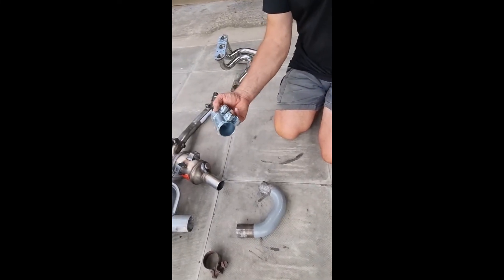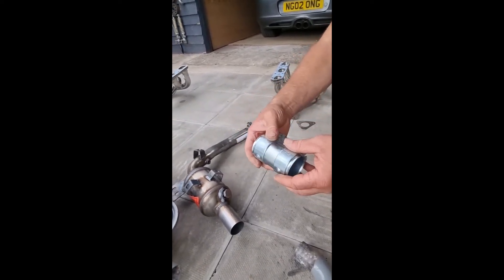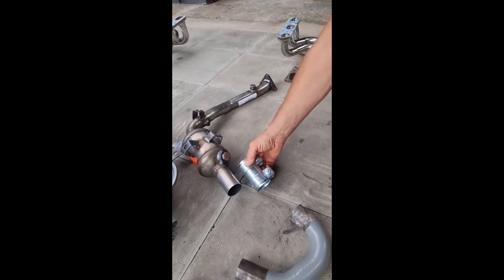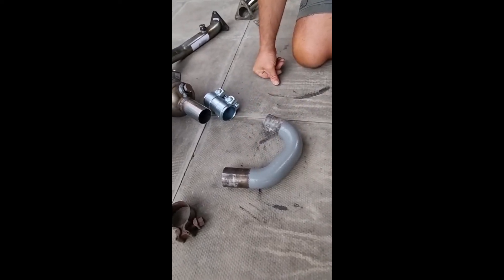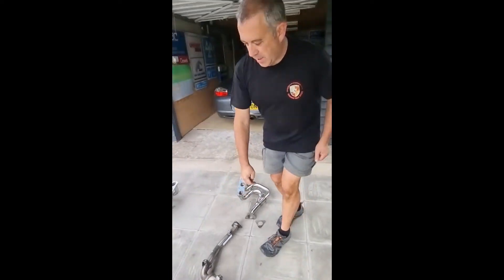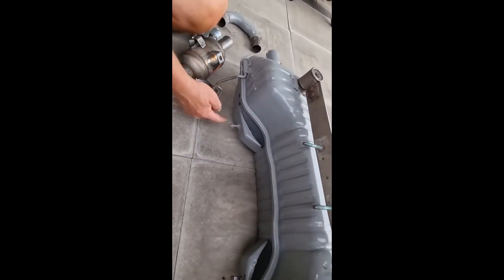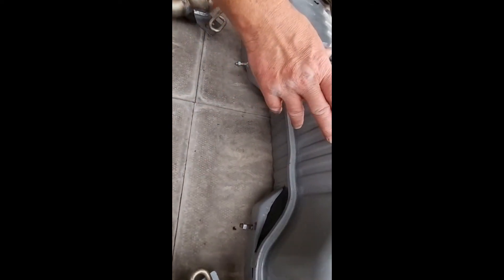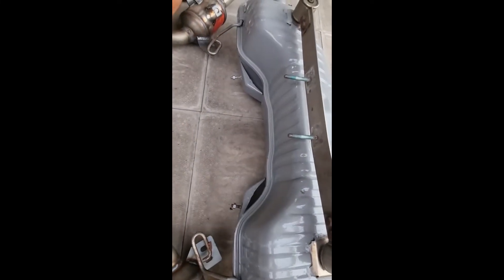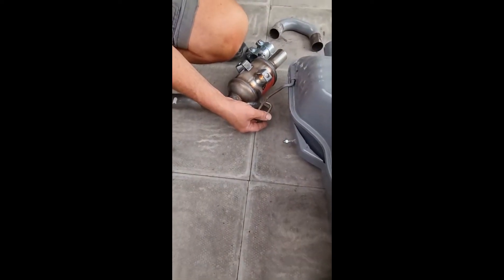As you'll see underneath the car, these are always rusty, so we'll probably have to cut the bolts and prise the clamps apart in order to move the sleeve and slide it down so we can pull the U-bend out of the way. Quite often the U-bend itself will get damaged because you need to tap it with a hammer and it'll compress and close the gap a little bit. On the back of the silencer, you can see the mounting points which hold it onto the car — two 13mm nuts at the bottom and two at the top, accessible from underneath the car. Some people prefer to take the bumper off for a bit more wiggle room. There are also two studs and two bolts that go through these brackets to hold them in place.